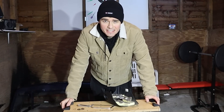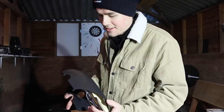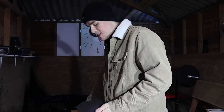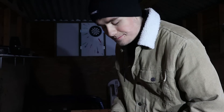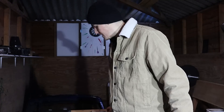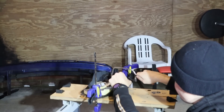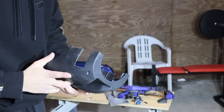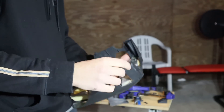It's the morning and it's cold and very windy. The proper way to do this is to spend an extra 30 quid and buy a lower cowling which has a gap for the cruise control stalk. However, I'm not going to spend 30 quid - what I'm going to do instead is cut a hole. I've measured it out: it drops about 5cm below the existing hole so I've drawn a little template. I'm going to cut that out and see if it fits. After a bit of backwards and forwards cutting and sanding, this is what we've got. Not the neatest thing - if there's a bit of a gap I might stick some electrical tape just to cover any gaps. Let's go take a look at what it looks like.